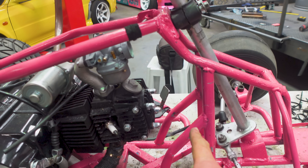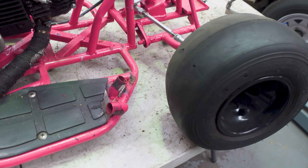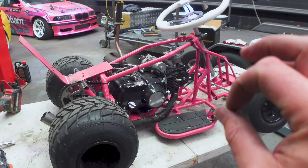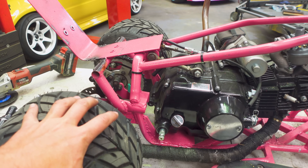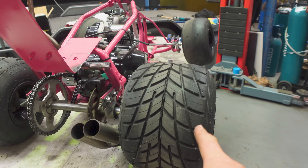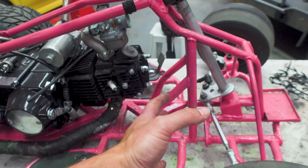Basically we're going to make some cuts — the whole front of the frame is going to come off the rear so we can make an extension and move it forward so the wheels don't touch. Extending the wheelbase also adds stability at high speeds. I don't want to make it hugely bigger — just a little bit more stable while keeping its compactness so it still fits under the stairs when we're not using it. We'll also extend the rear further back and widen the rear track, since the front track is currently wider than the rear.